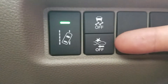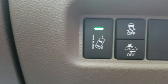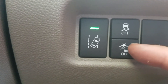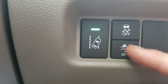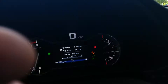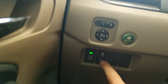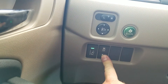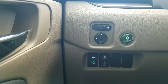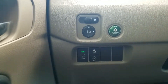Below that, you're going to see this button right here — this is for your forward collision braking system. It's always on, unless you press it. You have to press both these buttons for a couple seconds to turn them off. Now it's turned off — you hear the beep and then it alerts you up in the dash with an orange emblem. I'm going to turn this back on. It uses radar down in the grill to detect the car in front of you. First it'll alert you if you're going to hit them, and then if it looks like you're still going to hit them, it'll actually brake the car for you.